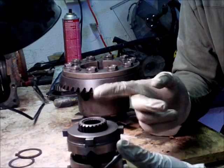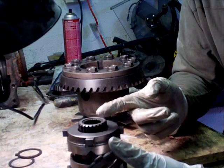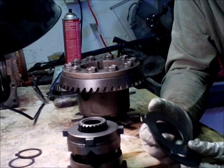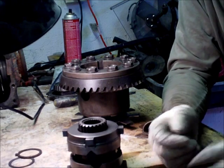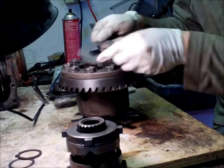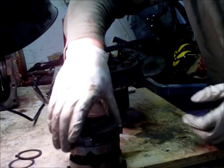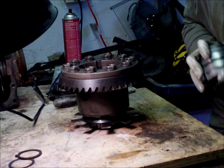Beamer World for E30 and E36 LSDs makes race-use clutches which will grab harder. The other way to increase lock up on BMW differentials and many others is to simply add more clutches — if you have more clutches, it's more friction and it'll lock up better. If you manage to remember how everything went together, it should be pretty easy to rip this apart, put everything back together, and refresh your own LSD. Thanks for watching — hopefully this explains it, and together with the tutorial online you'll get a better understanding of how a differential works.